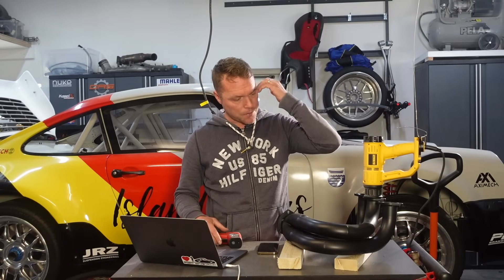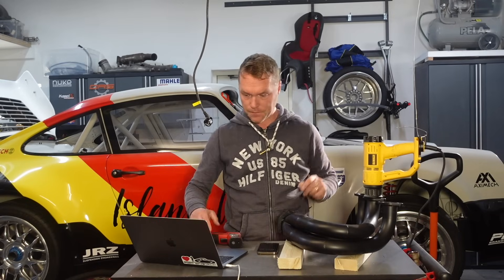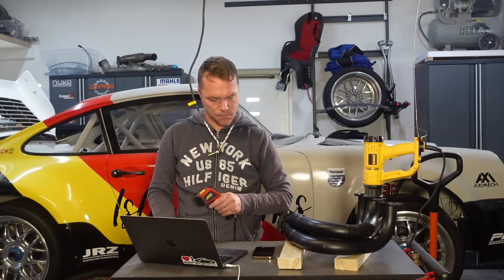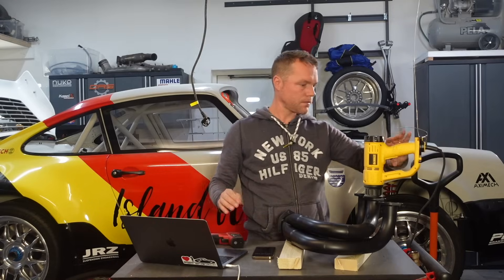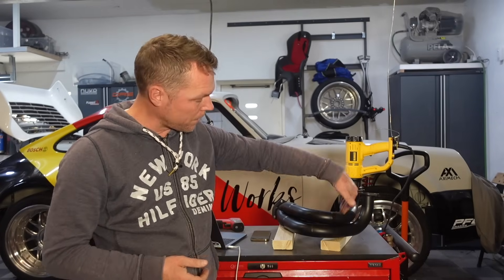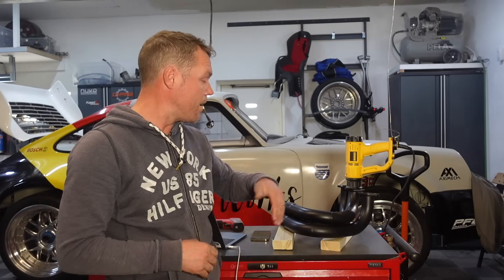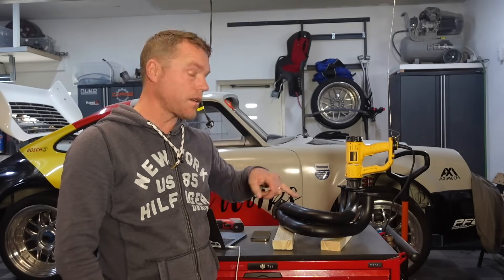Let's swap this for the coating. I'm going to do the same distance in from the heat source and start measuring now. The ceramic coating behaved a little differently than I figured — depending on the angle of the heat gun, the temperature is quite different. It's hotter on the outside, possibly because air is turning there, and it might also have to do with inaccuracies of the heat gun depending on the angle you shoot it against the surface. But it does run about 10 degrees hotter than the other one.